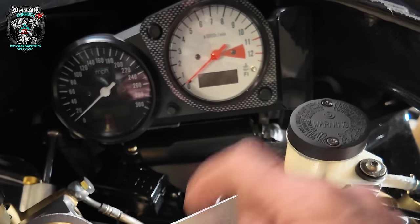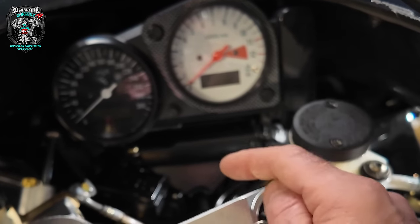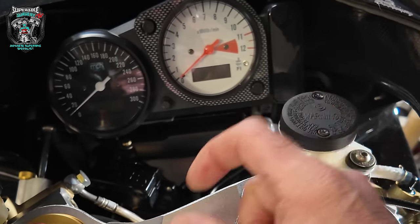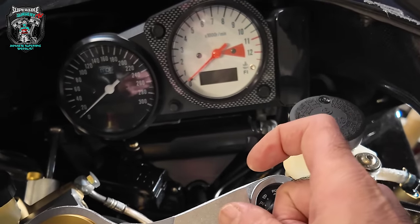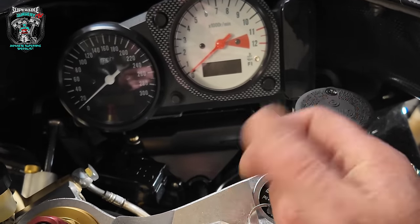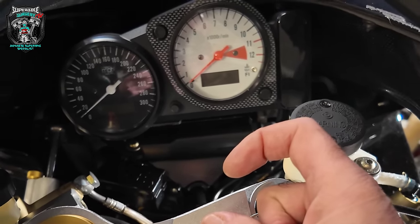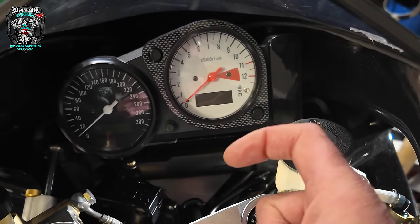The plan is: do the research on injector wire colours, then on Monday morning back-probe the injectors. I'll be interested in pulse width when it's cold and the amount of fuel it's getting. I'll put my wideband AFR meter in - there's a bung in the pipe for the rear cylinder that my wideband O2 will screw straight into. So I'll get AFR readings as it starts and look at pulse width of the injector.